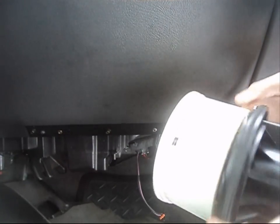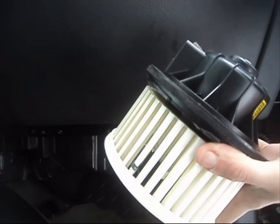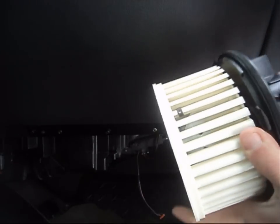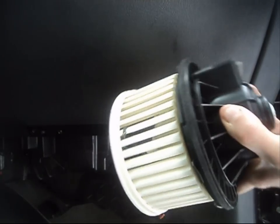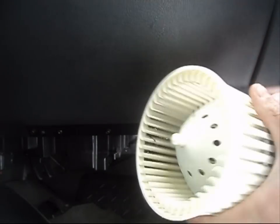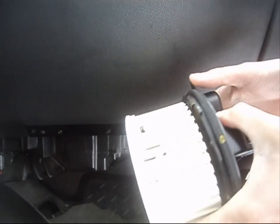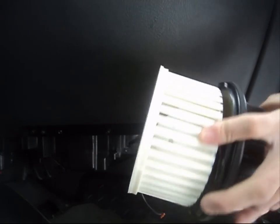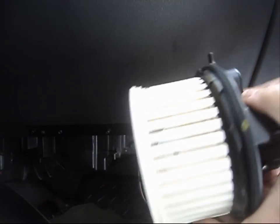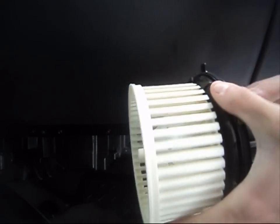We'll go ahead and take our new unit. This is a Delco. From past experience, if you go aftermarket, an aftermarket twist-in style unit will not fit in most applications. The electrical connectors on an aftermarket unit — the pigtail is actually coming out of the blower motor housing itself, which is not the proper fit. On most aftermarket models, the tab which holds the unit inside the base of the AC and heating unit does not exist, and unfortunately it will not stay in there. I had a problem where the unit was sort of seated in there and then eventually just vibrated itself out. So you're better off to go and get a GM part — trust me, it won't fit this application.